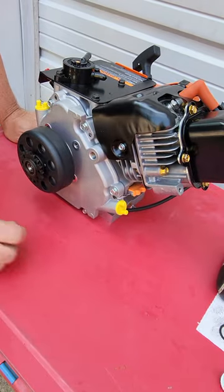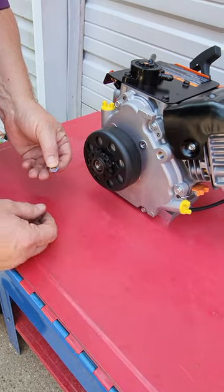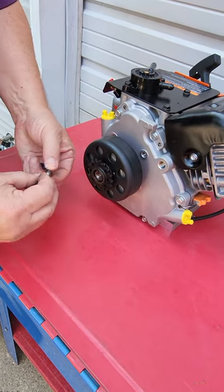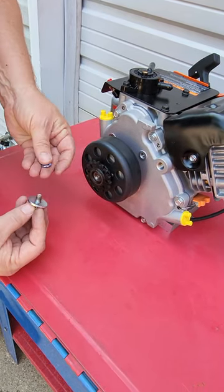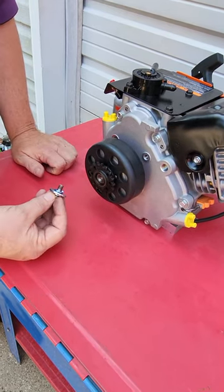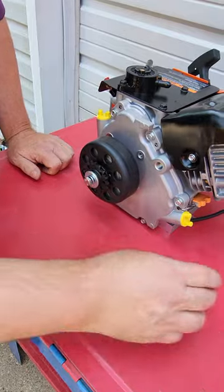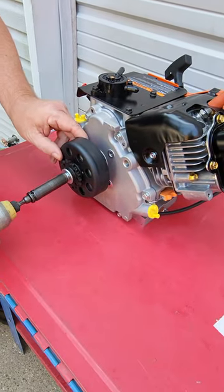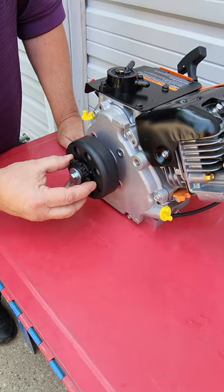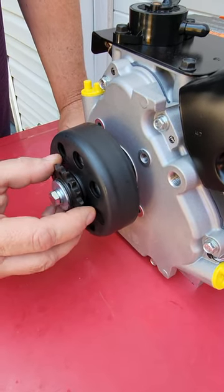Before we put our hardware on, we want to make a shim — either out of two 5/16ths AN washers stacked, or what I like to use is just a 5/16ths lock washer as a shim. Place them on the retaining bolt in this order: first the lock washer, then the retaining washer, then our shim. A little bit of never-seize on the threads really helps because you're going to be taking this apart each week for clutch maintenance. Get it started, then lightly run an impact in. We'll check end play on the basket — we've got about 30 thousandths of end play, and that's about where I'd like it: maybe 25 to 30 thousandths. Any more than that and I would go ahead and put a shim in place to bring it back down.